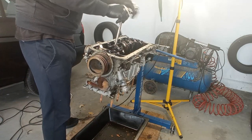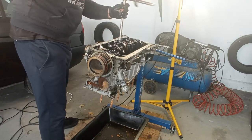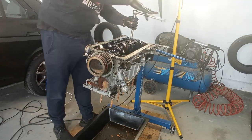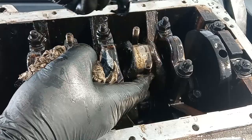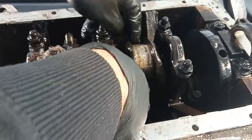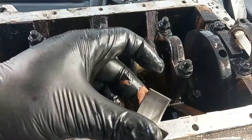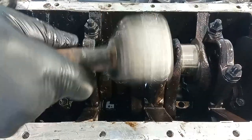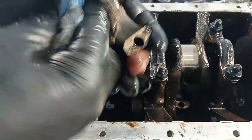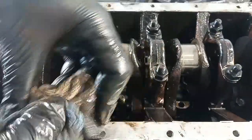My objective is to see the wear on the bearings. I don't want to reuse them, but I need to assess the wear because I need at least two con rods that are not bent for my engine. Fortunately, these four rods appear good — the wear on the bearings tells me so. Removing the big end nuts, a lot of water mixed with oil, but the bearings are nice. I have a bit more wear on one side, but with four con rods to choose from, I hope to find four good ones to use with new bearings.